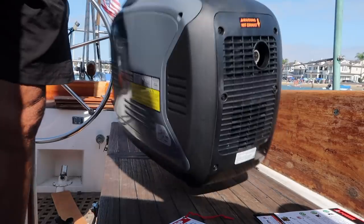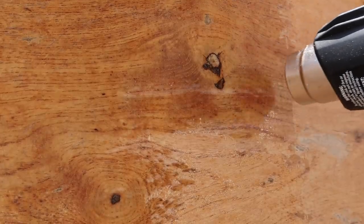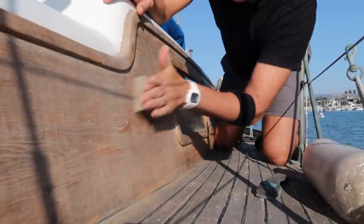Even though I'll have a video coming out about how to varnish, here's a quick summary of what I do. First, I get the generator on deck because there's no power at the mooring. I plug in the heat gun and apply it to the old varnish, then use a scraper to scrape it off one inch at a time — super tedious. After sanding it all nice, I put on a coat of epoxy sealer, let it dry for a few days, then put on five or six coats of varnish. I've now divided the boat into six sections to focus on one section per month, twice a year — the minimum to keep the varnish from peeling so I don't have to start the whole process over again.